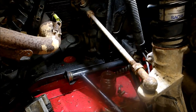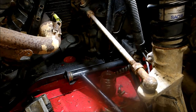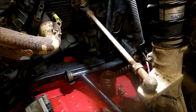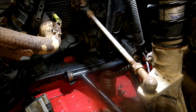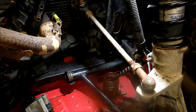Now I'm gonna squeeze the brake lever and bubbles should come out. You can see the bubbles — keep pumping your brakes. Keep an eye on the fluid level in your reservoir. She's tightening up, I can feel it's working.